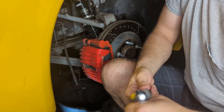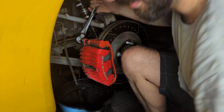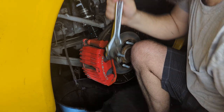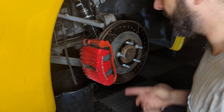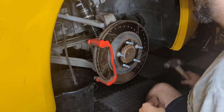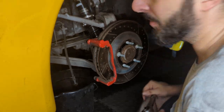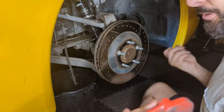Next you're going to need a 15 millimeter for your caliper pins up here. Chances are it's going to spin on the inside — it's like a little lock nut deal. You don't want to take it all the way out because when you try to get the other one off, the whole thing will kind of pop out. Get the bottom one loose first. This thing should just kind of slide off. As you can see, two pistons on this guy — the new one's going to have four. Next is the caliper bracket, which is a 21 millimeter. These can be kind of a bear to get off. And that's pretty much it as far as disassembly goes.